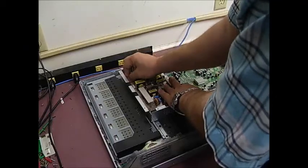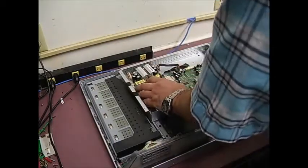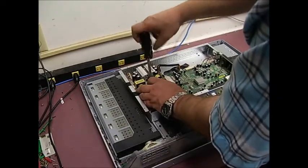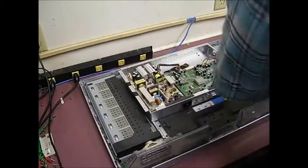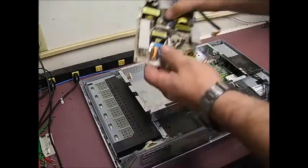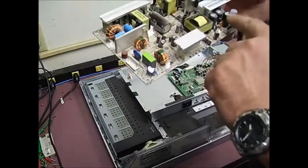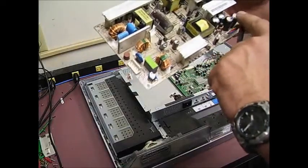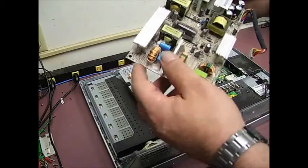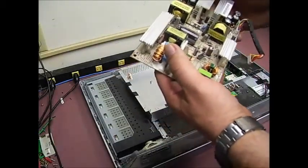The next cable goes from the power supply to the backlight inverter — it's a small cable on the side that just unplugs straight out of the socket. There are five screws as well. Here we have the power supply board, and several capacitors are very evidently bulging. We'll take it over to the repair bench and replace the capacitors to bring the TV back to life.